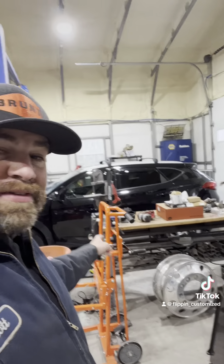All right, first things first — it's in the shop. Two things you're going to want to do on these modern vehicles: take your key fob and move it away from the vehicle at least 35 feet, and leave the driver's door open for at least 15 minutes to let the ECU fully power down before we unplug that throttle pedal. We'll get right back to you.